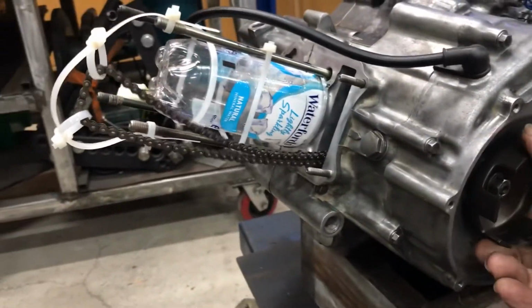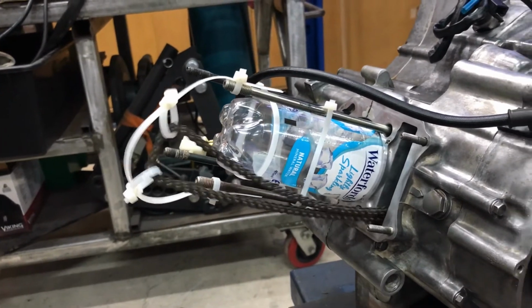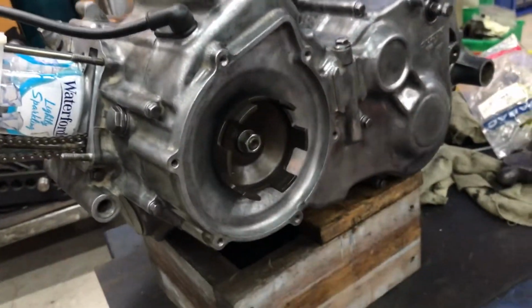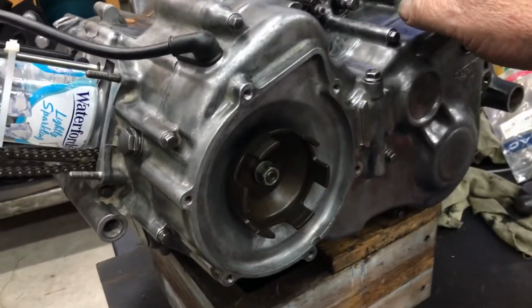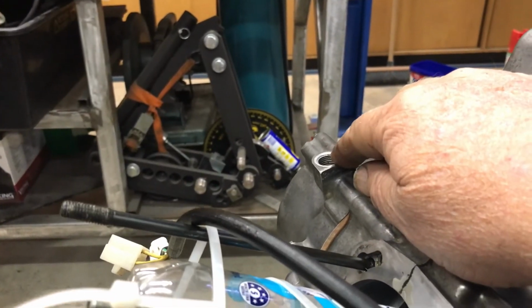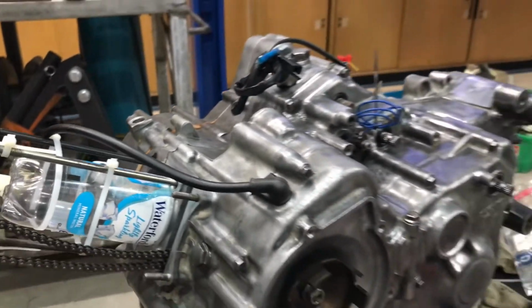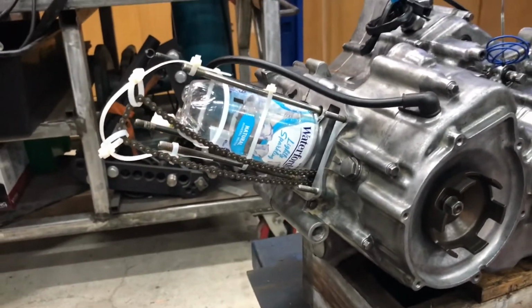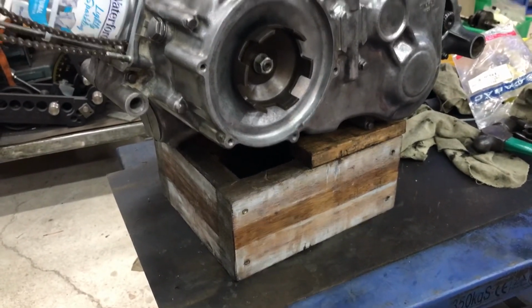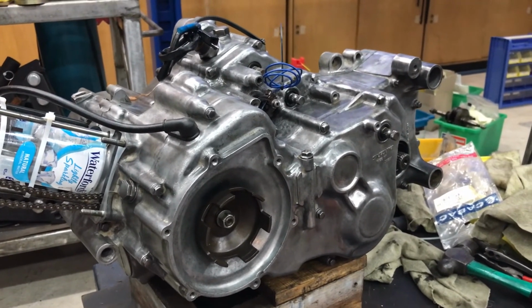Well, the crank rolls over quite nice. My little cable tie rig to keep the chain organised works pretty good. I've got the neutral switch, the reversing switch and the reversing detent in place. I haven't got the thermo switch for the thermatic fan in place. That needed to be out to get it into the frame, so I'll leave it out for now. Got it sitting up on my crankcase dismantling blocks. Makes it sit fairly horizontal, even though it's got a very uneven base on it.